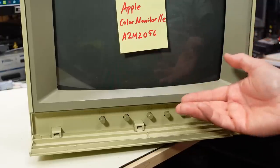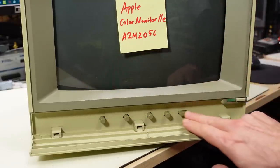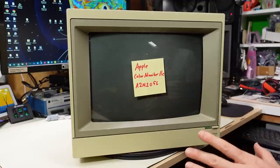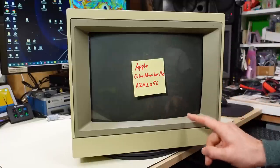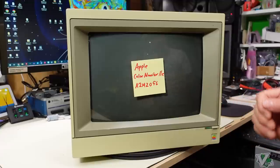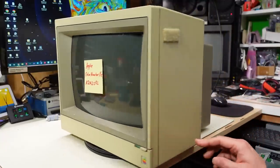For color graphics, Apple IIs use artifact color - it's an NTSC thing. If you try to look at 80-column text in a graphical mode, the text is all rainbow colors and completely unreadable. But when you push this button, it changes the entire monitor into a high resolution monochrome monitor that renders the text nice and sharp. There's also a really cool feature unique to the Apple Color Monitor 2E and 2C: when the color killer circuit is enabled - meaning the NTSC color decoder is not detecting the color burst - it automatically switches the monitor into high resolution monochrome mode. A typical monitor like the 1084 or 1702 still has video filtering and notch filtering enabled on the video signal when the color killer is active, resulting in very soft text. That is not the case on this monitor, giving you a nice sharp image.